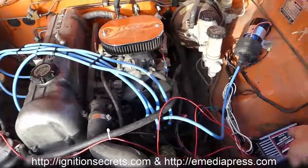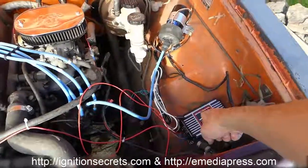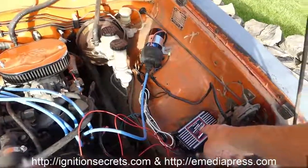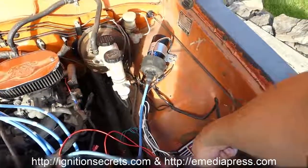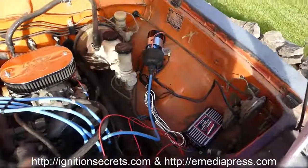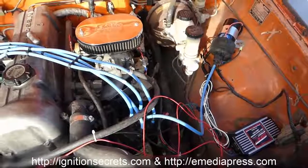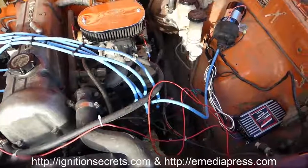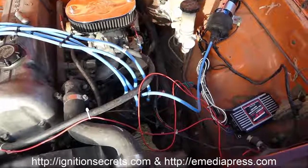a low voltage, high current punch at a negative resistance. This is high voltage, low current at first, then you get a low voltage, high current punch. That is an accelerated discharge on this cap, faster than you're normally supposed to be getting, because the high voltage here is pulling on the high current here simultaneously over a gap. And so the low resistance or negative resistance effect does not just happen at the gap; it's actually happening over the circuit into the capacitor, and I've done multiple experiments to give some evidence that that is actually what is happening.